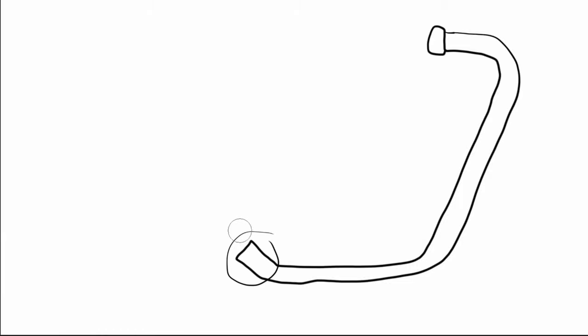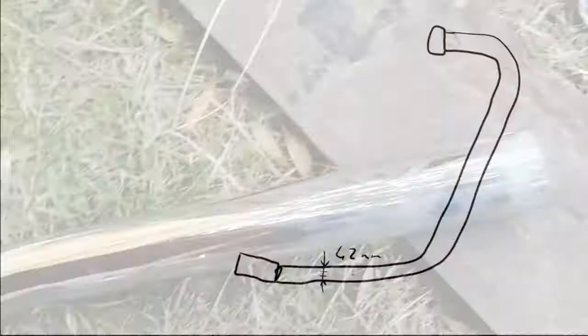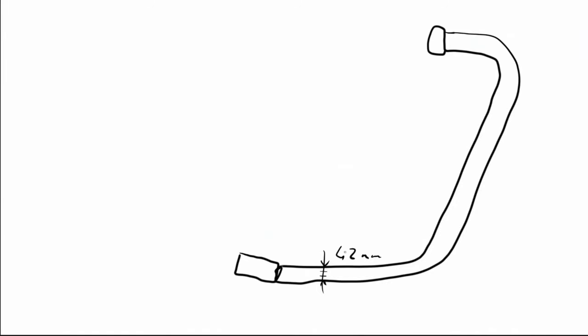My plan is to basically cut out this bit and make it less angled, and that will be the weld. It's made of stainless steel. That diameter here is, as far as I remember, 42 mils, which is much wider than the original. The original stock pipe has a pipe-in-pipe, so that diameter is like 28 maybe — really restricted. That's the reason I'm putting this pipe in.